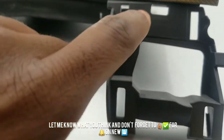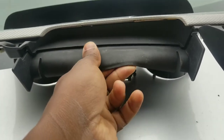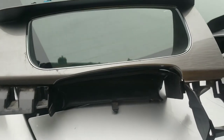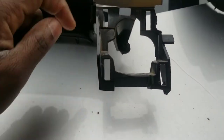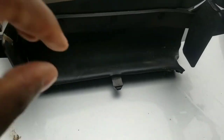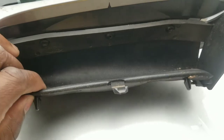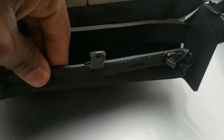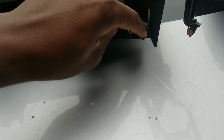Don't forget to take that screw out as well, and you should be able to take it out. As you can see, this is just a plastic cover that lays on top of the steering wheel column and it's not attached or anything like that. Now if you have a 2013 and up, it's pretty much the same thing, but you still have your screw here which sits in a deeper hole — it's still the same 7 millimeter screw. On the plastic, which is kind of like a full leather or fake leather type of thing, you have to go ahead and pry it out using your prying tool to take off the top of the steering column.